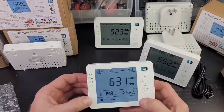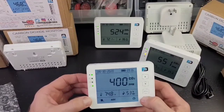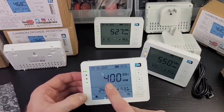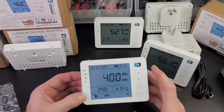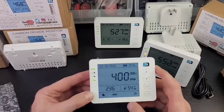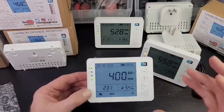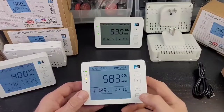If you want to go into calibration mode, press enter. To actually calibrate, hold enter down for three seconds and it will start calibrating. You'll get a 250-second countdown and it will calibrate to 400 parts per million of carbon dioxide. This is only done in special situations — keep the monitor outdoors for 30 minutes before doing this, and then it will recalibrate to the outdoor carbon dioxide level.